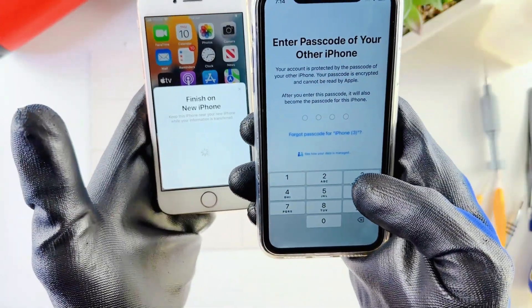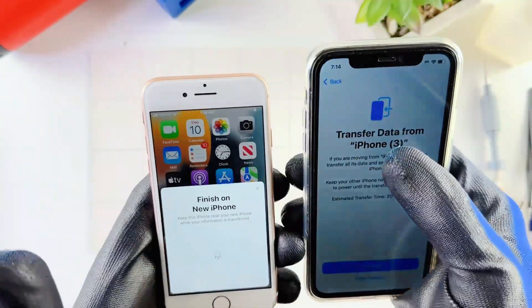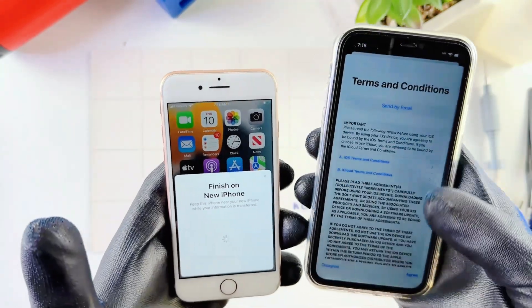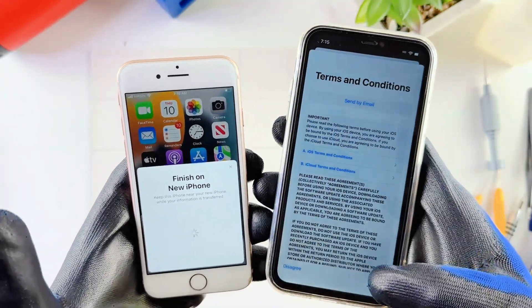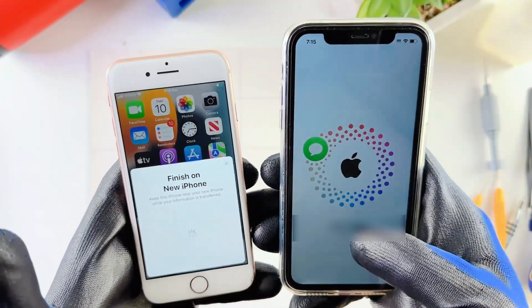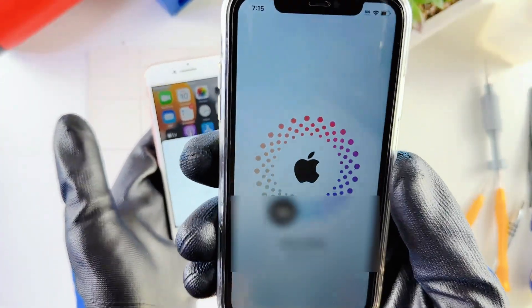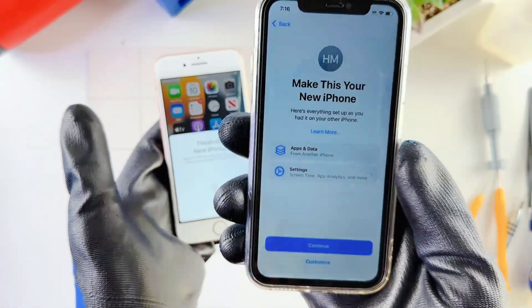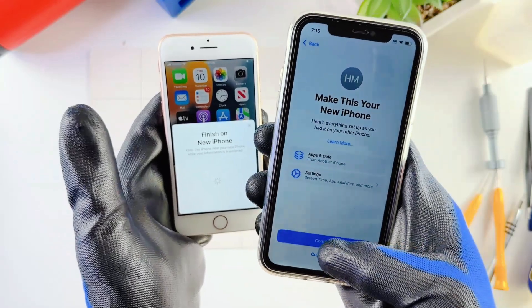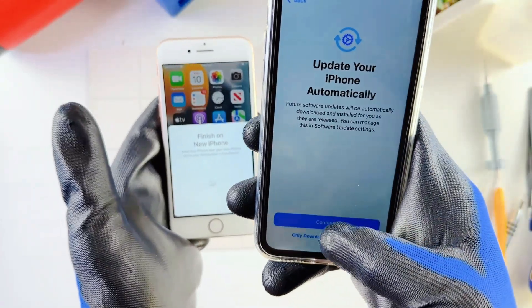I'm going to go to my old iPhone and choose Set Up for Me. Now the new iPhone needs me to put in my passcode. I'll type in my passcode. Set up Face ID we can do later. Hit Transfer Data from iPhone, then Continue. Terms and conditions — I'll just agree. We can see it's signing in. If you get an error message around this step, it might need you to upgrade your software to the newer iPhone software, so make sure you upgrade to the latest iOS.